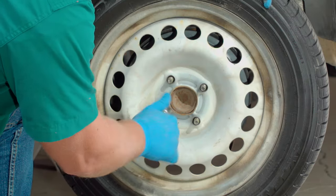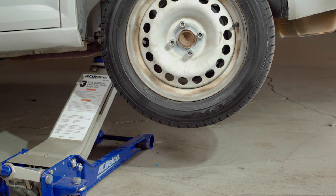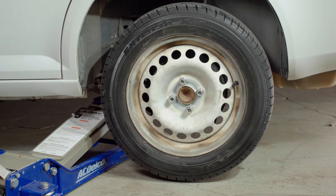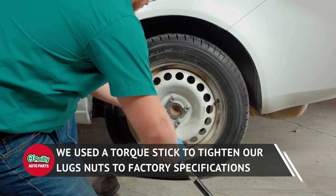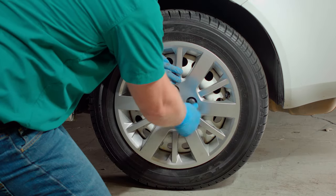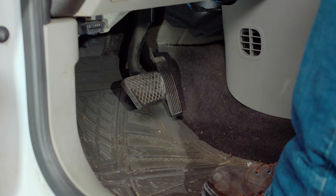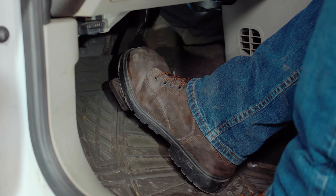Once you've got your wheels back on, finger tighten the lug nuts and let your vehicle back down. Then tighten your lug nuts in a star pattern. Use a torque wrench to make sure you tighten them to manufacturer specifications. Once the job is complete, before you drive anywhere, be sure to pump your brake pedal several times until you feel the pressure return — it should feel the way it did before the brake job. Check your master cylinder and add fluid as needed. You may need to adjust your brake shoes after driving a few hundred miles, or if your brake pedal engages too close to the floor. If you do have to push your pedal down to the floor before your brakes engage, adjust the brake shoes so that they're tighter against the drum.